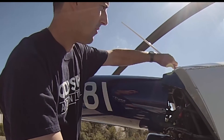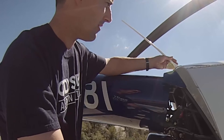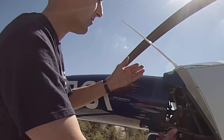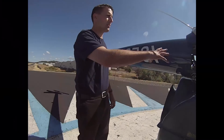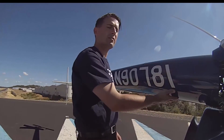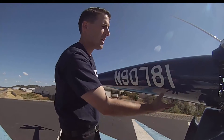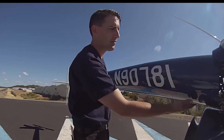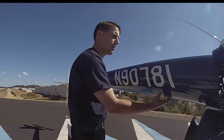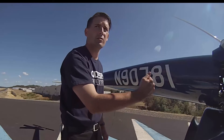You also want to check that the antenna is tight — put your hand on there and wiggle it a little bit, but be gentle so you don't rip it off; just make sure it's secure. As we start working our way down the tail cone and empennage, we're checking for any wrinkles, creases, or ripples. If the helicopter's had a hard landing, you'll notice ripples on the underside of the tail cone. We want to make sure those aren't there and that the tail cone isn't drooping.